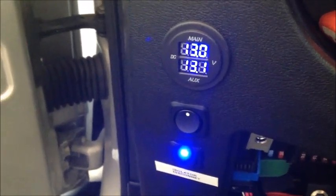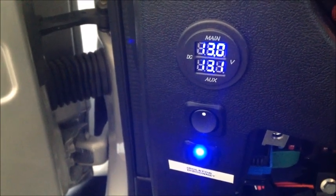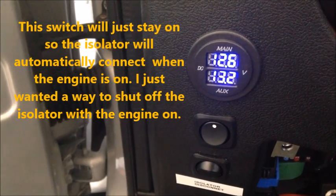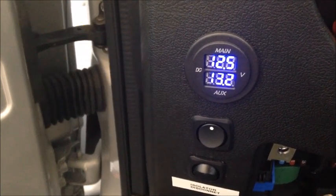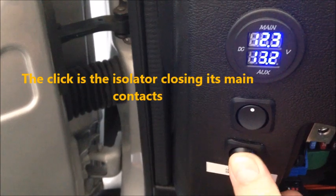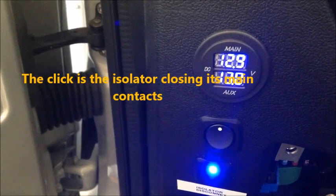Back to this for just a minute. Right now my ignition is on, and you can see that the two batteries are connected — the house battery and the start battery. I can turn off my little switch and it disconnects them. Now the start battery goes back to its resting voltage and the house battery sits at its resting voltage — the isolator kicked off. If I turn the switch on again with the ignition on, you're going to hear it. Hear that little click? That click connects the two batteries together and they both come up to equal voltage.